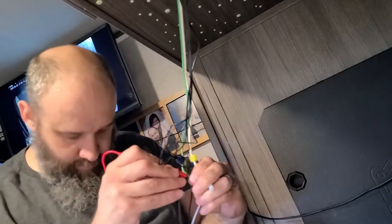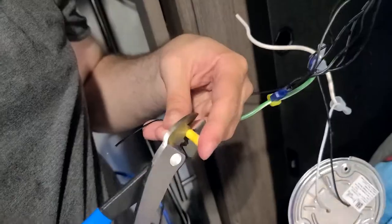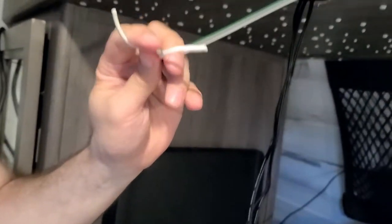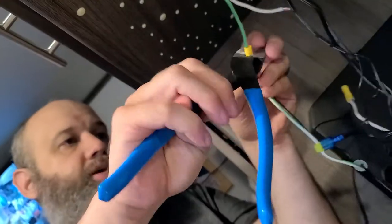I know it's running to these lights. These lights are actually pretty fantastic — they pop on and provide a lot of light. I could really splice this in anywhere, probably right in here. This is positive, this came with the kit. It's kind of short, so basically you've got to find a wire that is close enough. I splice those in positive and negative and then attach it to this live wire.